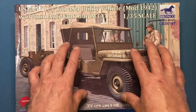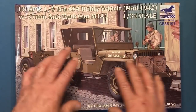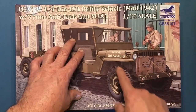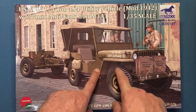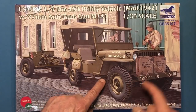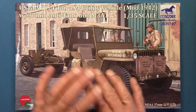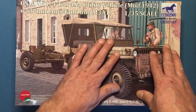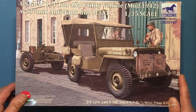They've got a Ford-scripted body, so they're actually Ford GPWs — Ford made the vehicle 100%, they made all of it. If you're a bit of a Jeep fan, these were Ford-scripted vehicles, so every single part of this vehicle either had the Ford logo on it, was stamped with an F mark, or cast with an F mark — even the bolt heads had an F stamped in them. The Willys would have had CB I think it is. There are also differences with the sump bolts — they've got recessed heads. If you really get into the Jeep world it's a minefield; there's so much really interesting nitty-gritty detail. If you're a modeller who tends towards the rivet-counting side of things, you'll absolutely love the Jeep world.